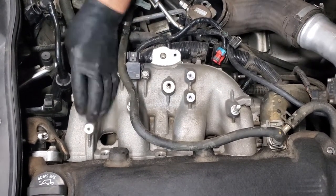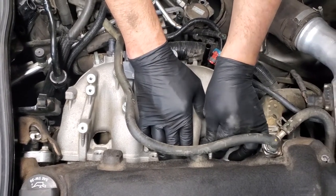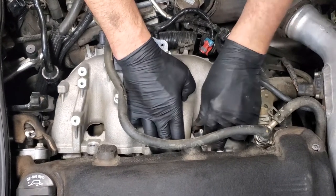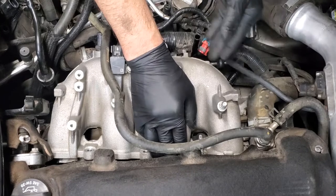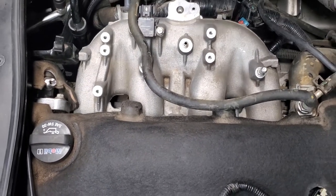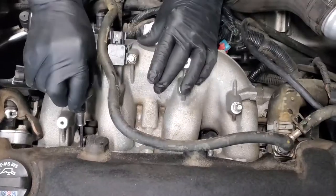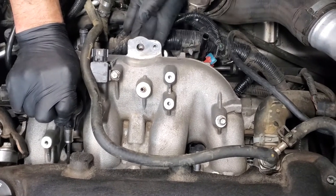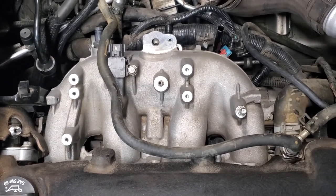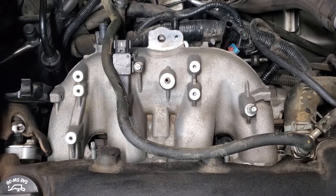Okay, that's to the point where I can probably work it on the studs if I start putting studs in. On your intake manifold gasket, if you look back in the video, you'll find out there was a little tab you can kind of pull on. And obviously I got to get the tab pulled on and get the hole and everything to line up over here and get the stud restarted. All I want to do is start it because I got to get the opposite end on here too. I'll make sure I line it up. I'm going to get myself an awl. I'm going to use an awl to make sure I lift the gasket on the end closest to the passenger compartment. Try to keep it in place. Now I'll get the stud and put in there. Now we'll be trying to get our stud started on this end. Okay, it looks like I probably got that started. So I've got the two studs started.